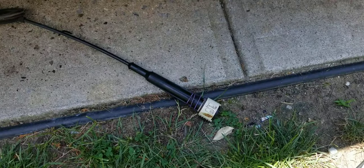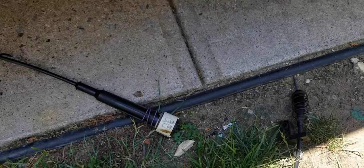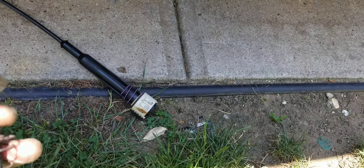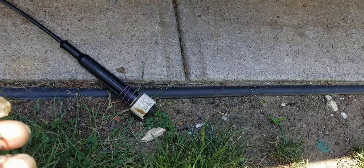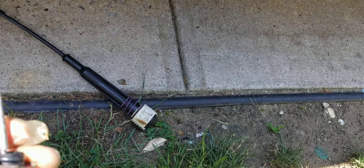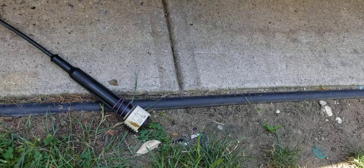I was absolutely going bonkers — I spent four, five hours on this trying to figure out why it was too short. I was thinking maybe it's the wrong cable, but it wasn't the wrong cable, it was the correct cable. So what happens is, if you guys catch it all the way at the end, it's going to be too short to lock it in. You guys are going to have to take it apart, take the E-ring out, and once you do, there's very little chance of putting it back in. Those things break, and it's very, very difficult to snap back in.